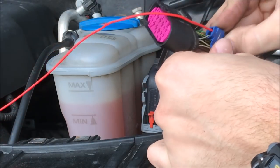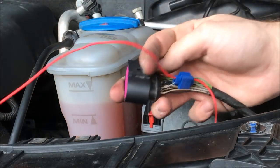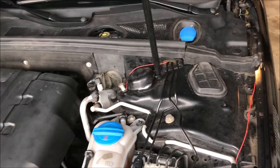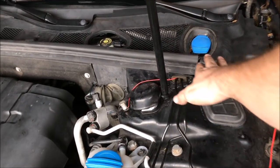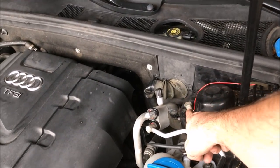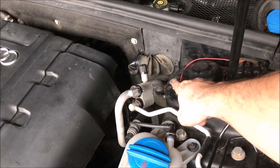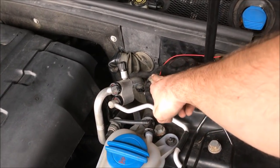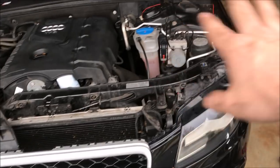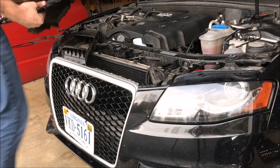Take your crimp tool, make sure the metal piece goes all the way through to get good contact to both wires. Once that's done, take the clip and fold it over until it clips into place. Plug the headlight connector back in. I ran the wire up through underneath the weatherstrip, in through the cutout for the brake lines, and connected the negative to the negative terminal post. It all looks clean and tidy — you can't even tell there are any wires except for the red one. Put the plastic cover back on.